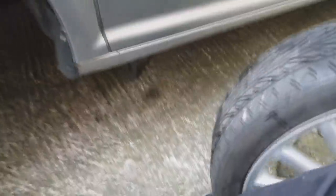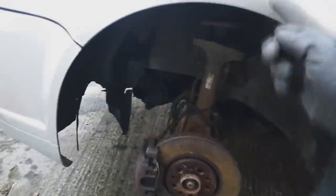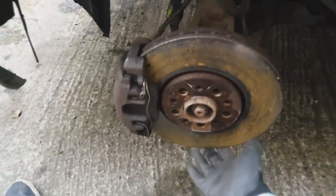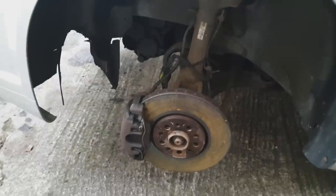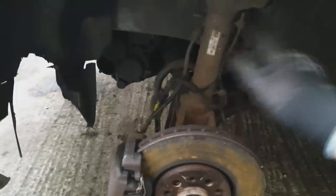There we go, tyre off. The car hasn't been driven for a couple of days — look how good that tyre is. Now we get our first look at the suspension. We need to pull these brake pipes off from the side of the strut, undo the big bolt there and the one above it — that's what allows the strut to come out. We'll use our jack to support underneath so it doesn't drop and break things. Up top there's a cap which comes off to reveal one nut, and then that strut tower should drop out.